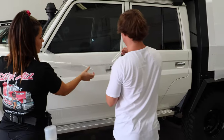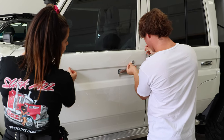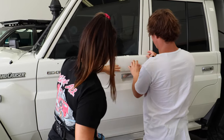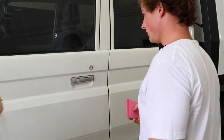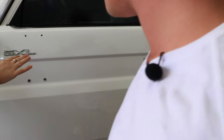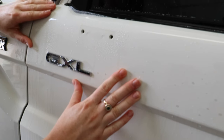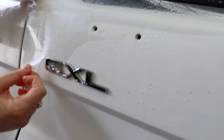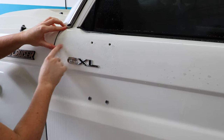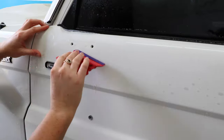This should just line up nice and easy - this top strip. Make sure it's wet enough. You can see that it goes around the little keyhole. Now when you first lay this, it looks a little bit short, but it's not. That's the way the template is designed because I'm going to start at the back near the keyhole and then we're going to stretch this film into position. The film is super flexible and that's what it's meant to do - we've designed it so you do need to stretch it. Stretch that forward and all of a sudden your corners line up, the badge lines up, the holes line up, and then you can go ahead and simply squeegee it down.